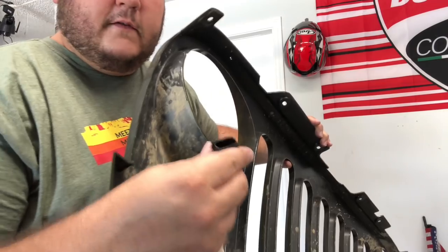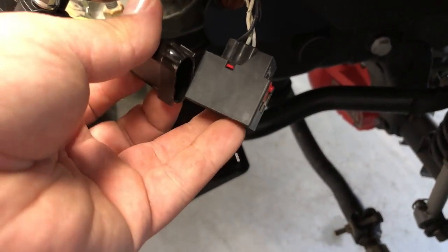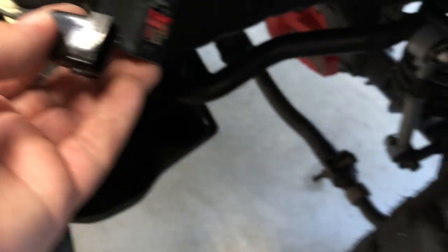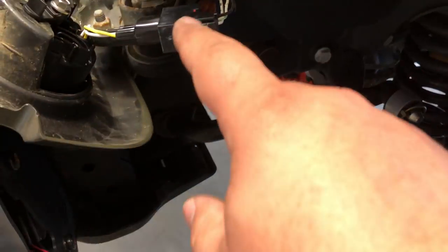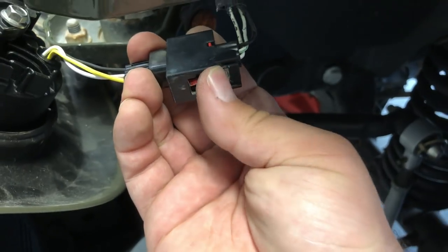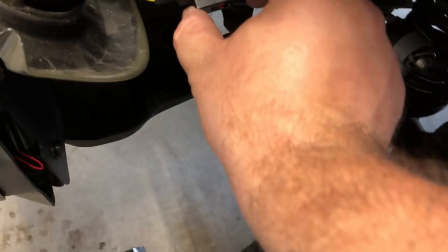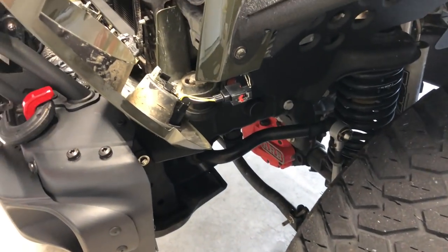Now you take that wire that we disconnected, plug it back in, push the grill back on, and I'll show you what they look like. The plug on the JW Speaker blinker has an extra little tab on one side. That's going to go on the side where the red clip goes — that little extra tab piece goes right on the same side as the red clip. Make sure you push it all the way in, you'll hear it pop just like that. Lock that down and it's a tight connection, it's not going anywhere. For extra security, if you really wanted to, you could put a zip tie right around this to keep it in there.